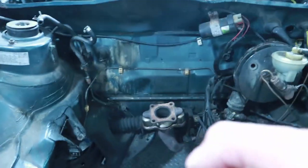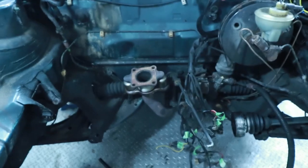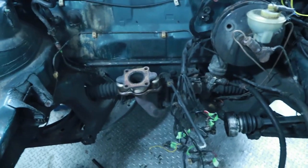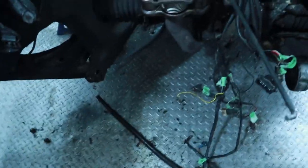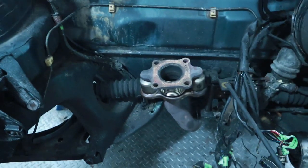This is a power steering rack, and I'm going to be putting in a manual steering rack because my power steering pump never worked. So might as well just go with manual steering. It's also going to clean up the engine bay — I don't need these power steering lines or the power steering reservoir anymore, so we're going to remove all that.